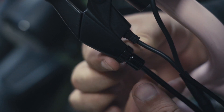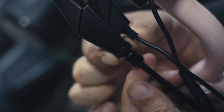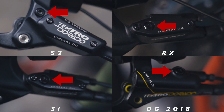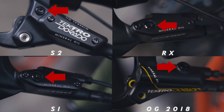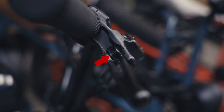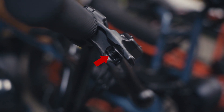If your bike has mechanical brakes, there is a barrel adjuster at the lever housing that can extend the housing length for cable adjustment purposes. Hydraulic brakes are designed to use brake fluid, so if you have hydraulic brakes, your brake lever housing will have a fluid reservoir that can be accessed to add fluid or bleed the brakes. On the inside of the hydraulic brake levers, there is a reach adjustment screw that can be tightened or loosened to adjust the grip of each lever.